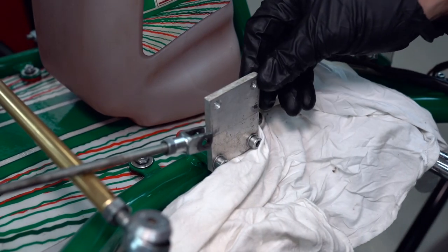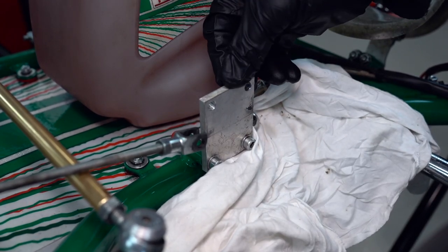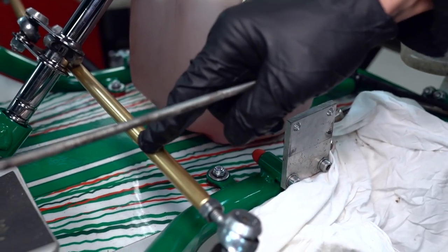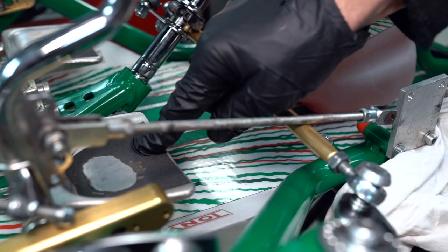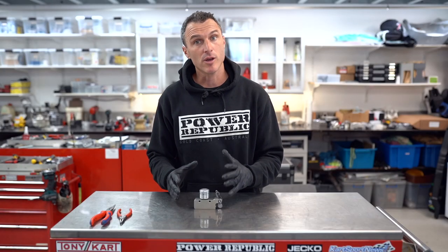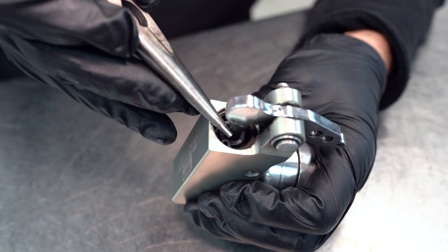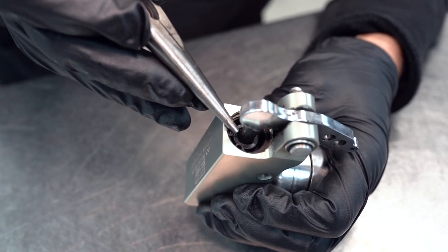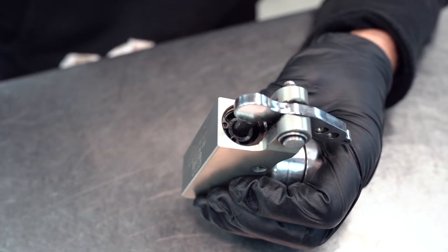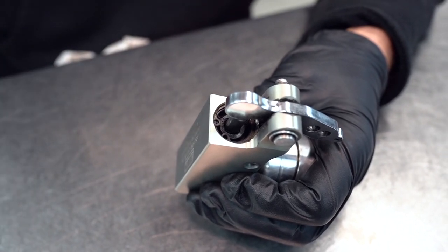This car has been retrofitted with an aftermarket riser bracket for the brake master cylinder — or the brake pump — so that the brake rod will clear the tie rods when the driver's steering, using the pedal platform from Tony Kart that lifts the pedals up for those little drivers. Now that you've got your master cylinder removed from the go-kart, it's time to change those seals. This car has been used in the rain and there's a lot of mud, dirt, and water that gets up between the piston and the seal and wrecks the pump seals. That's what we're changing in today's video.